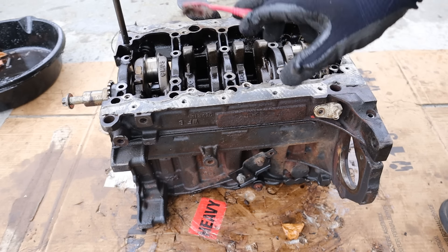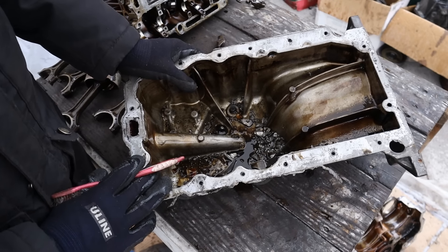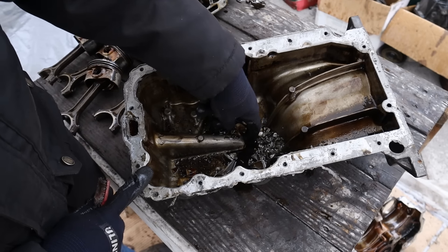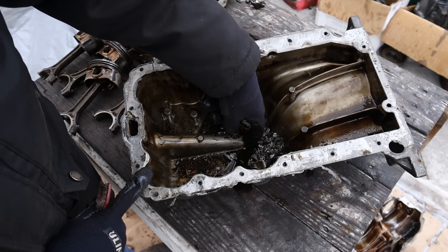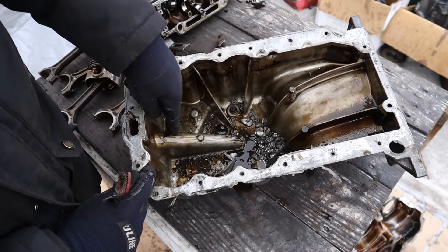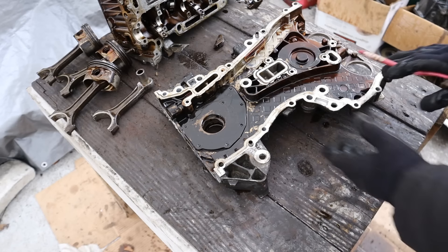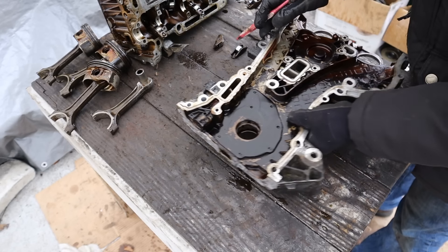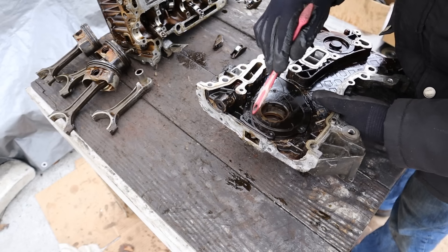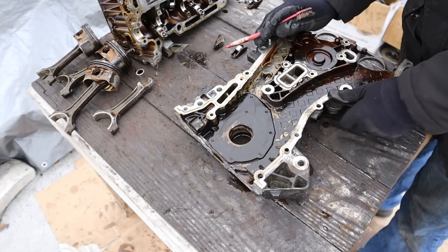Now that we've got this engine mostly taken apart, we're going to take a quick look at how it works. We're going to start at the bottom of the engine here where we have the aluminum oil pan. The oil pickup tube is actually integrated into the bottom of the oil pan, drawing oil from right at the bottom here. Kind of a shame that we can't really see the screen or if there is any, to check if any particles have made it inside to clog the oil pump. Next up we come to the timing chain cover — the oil pump is integrated into the timing chain cover, and it's going to draw that oil in, create fluid flow with the rotation of the crankshaft, and then send it out to the engine block.